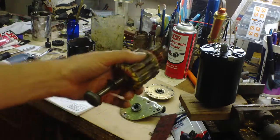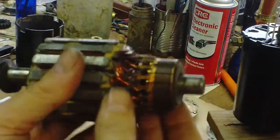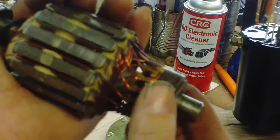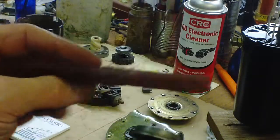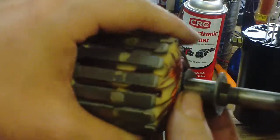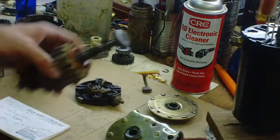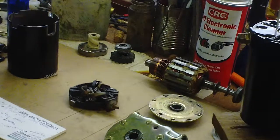You want to clean this commutator quite a bit - this one's obviously nasty. Clean it first using some electronic cleaner, then polish it until you get it nice and shiny. You can do that on the bearing surfaces too. I use some scotch-brite - fairly coarse but it shines it up good. Then I use some high-temp grease, like wheel bearing and brake grease, the high-temperature stuff.